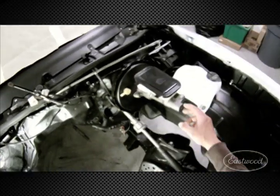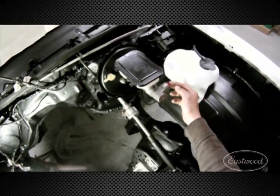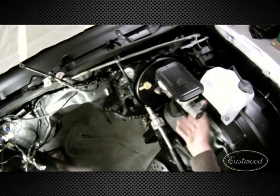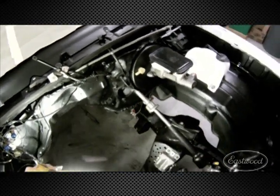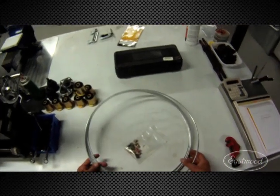We don't just bend something down here — what we want to do is put some strain reliefs in. We're going to come down and do a couple of coils down there, that way we have some relief from the movement between the frame and the firewall here. So let's go bend some.